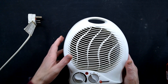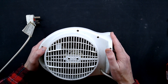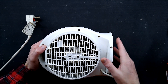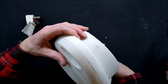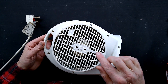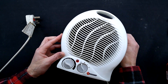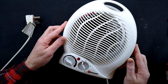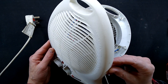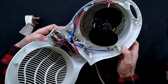Now there are two thermal protection devices. I'll just open it up - that's the best bit. I've taken all the screws out because it was doing its best to stop us getting in to explore this. There were two anti-tamper screws and one super deep screw, but they are out. The heater assembly is mounted to the back and the thermostats are mounted to the front. So when you open this up, take careful note of the route of all the cables, and also make sure - kind of important - that it is unplugged.